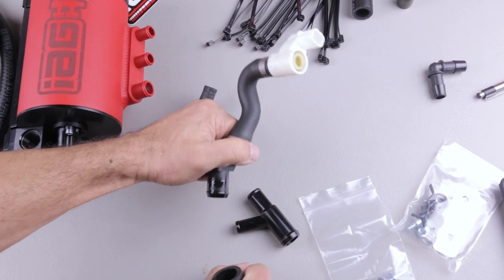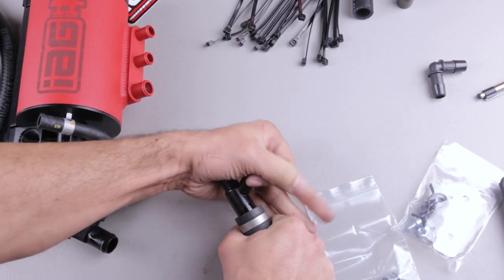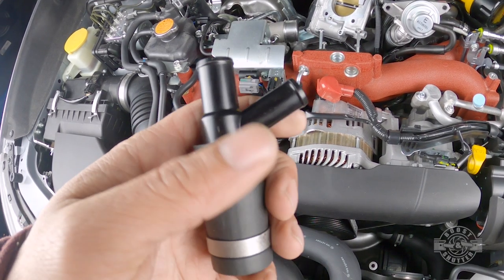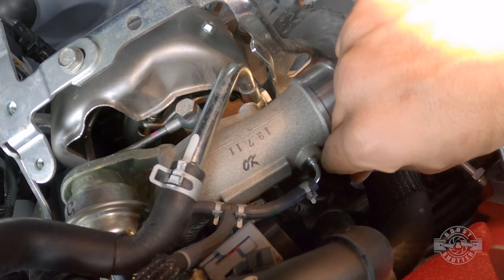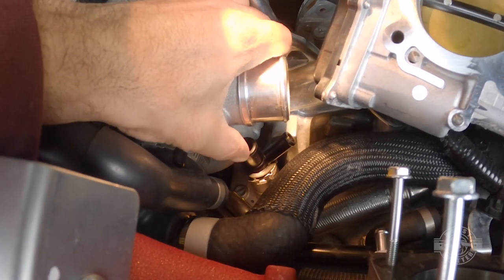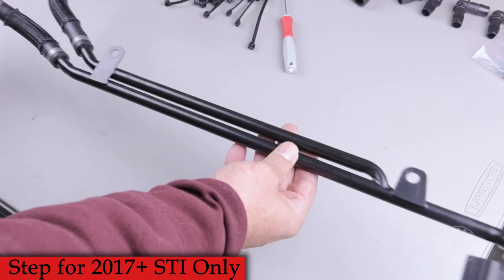Take the Y-splitter and put it in place of the drain hose on the assembly. It's quite tough to get in — use engine oil to lubricate the splitter so it slides in easier. Putting the drain hose back can be challenging: flip the hose so the adjustable band is on top, lubricate the inside with oil, work the hose over the barb, and push it all the way down flush against the block. Then angle the splitter close to what you see here.